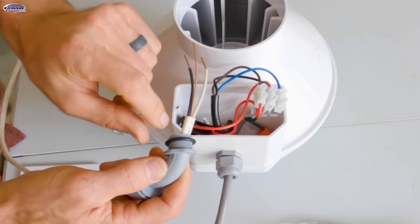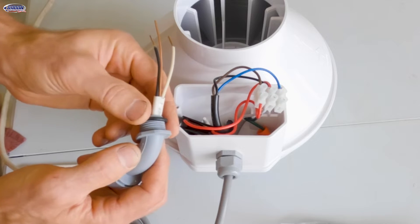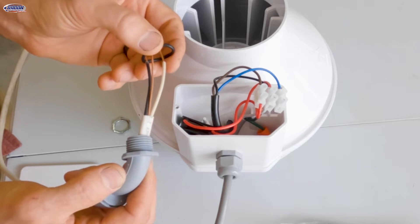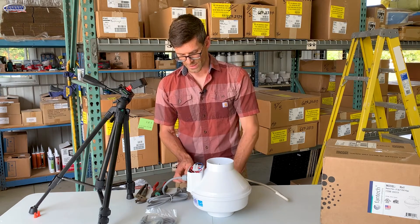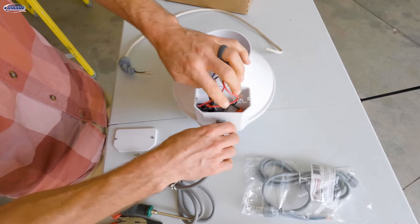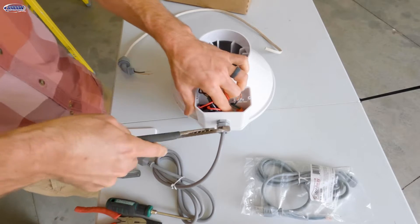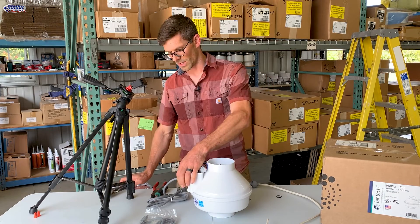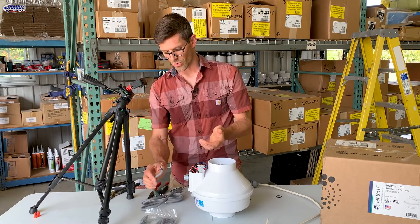A lot of these rubber o-rings are deteriorated and cracked on outside systems where I have to replace that. To replace it, we'll put a link down in the description to the 90 degree turn. So next we can remove this cord — we're going to use our channel lock pliers and loosen the outer nut, then remove the wire nut and now we've got our cord removed.